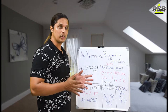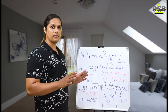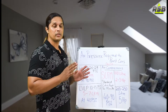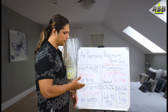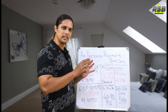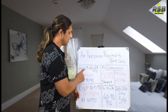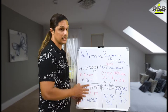If you have a small compressor at home — around a 100 liter compressor — LVLP spray guns are best because they use air in low volume. If you connect an HVLP spray gun to a 100 liter compressor, it will finish your air in very little time. So if you have a small compressor, try to use LVLP spray guns as much as possible. To recap: for HVLP spray guns you need 26 to 29 PSI, and for LVLP spray guns you need 10 to 15 PSI.